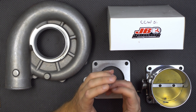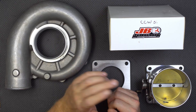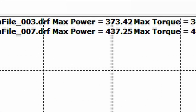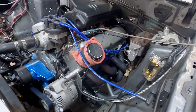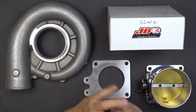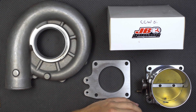If you've been following along, you'll know that we've already made 580 flywheel horsepower, about 437 rear wheel horsepower on a dyno through the Power Glide. We can figure out the losses because we know the duty cycle of the fuel injectors and the fuel consumption, so we can make a pretty good guess. We did that all on just 2 psi.